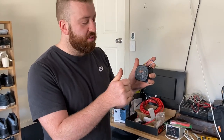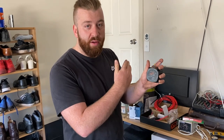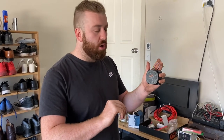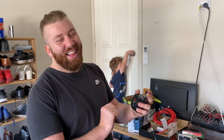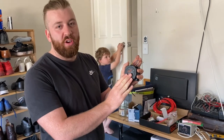Basically how it works: when the car turns on and the alternator starts working, your crank battery goes from sitting at 12.6 volts up to 14.4 volts. When that happens this isolator will cut in at around 13 volts and allow current to flow back to the second battery. But as soon as you turn the car off and the alternator stops working, the voltage drops back to 12.6 volts, the isolator turns off and disconnects the current - so you don't get any bleed through between the batteries. Basically it acts as a voltage-dependent circuit breaker.